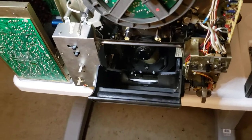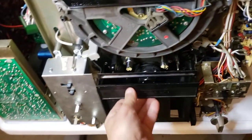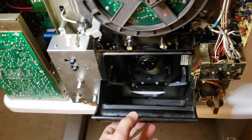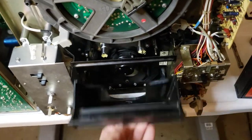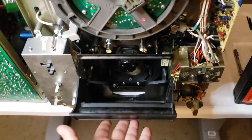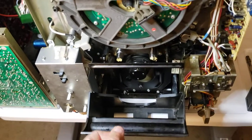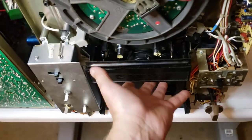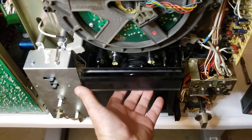The biggest problem with CartriVision — a lot of issues had to do with the loading door. As you can see, I did repair the loading door. I got it back in alignment. The alignment on the loading door is really kind of messed up. I pull it, it goes in and out. Sometimes they're completely stuck in place; you can't even move them or open them. See how free and open this is now? The loading door is completely in alignment.